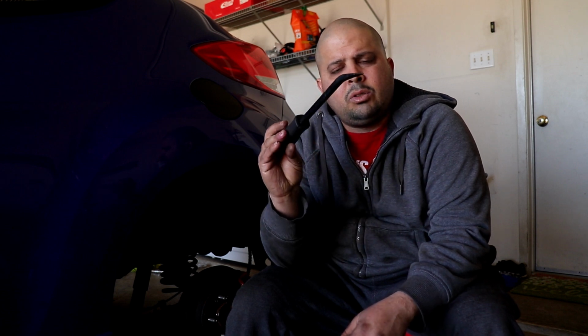Here's what happened. Yesterday, I mean, this is the second day working on the car. So yesterday, I started disassembling everything. I didn't record the whole thing because I encountered some hiccups along the way. The rear hub was frozen. It was like welded to the back, so I had to spray a lot of WD-40, wait for like a half hour. I gave it a little bit of heat. I hammered it a lot. I used this to hit it with a hammer and try to separate it until it finally came out. It took me well over an hour to do that. It took me too long.